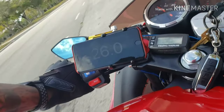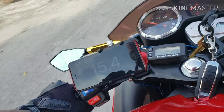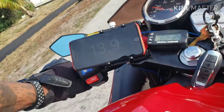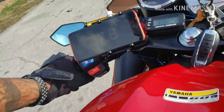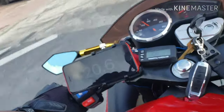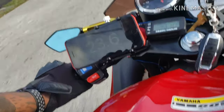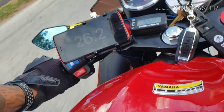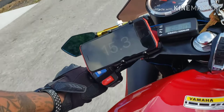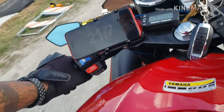Not too bad so far. Doesn't feel bad. So my RPMs aren't too high. I still have the same size variator as the 2000 RPM, so I wanted to see if I needed to be lighter or heavier. I don't know. Feels good though. It doesn't feel as snappy on a downshift as the 2000 RPM one. But I'm gonna see how this picks up.